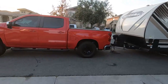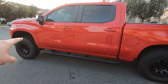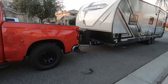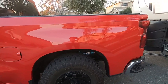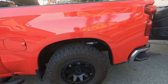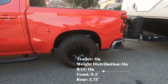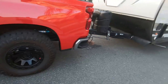It's very important to have the truck as level as possible and the trailer as level as possible with the correct equipment. Don't exceed the truck's limits, and avoid too much cargo in the rear of the trailer creating sway. So we got the truck and trailer all set up. Right now we're looking at nine and a half inches in the front — exactly how it was the first time — but in the back it gained quite a bit. We're at about five and three quarters inches, and before we were right at four inches — so we gained about one and three quarters of an inch.